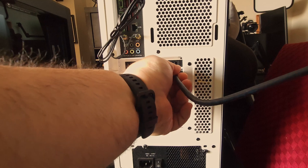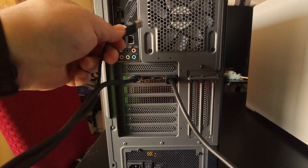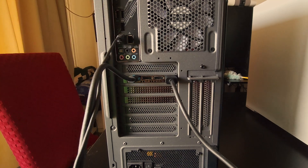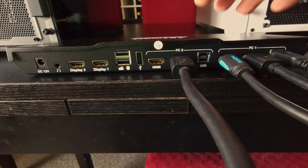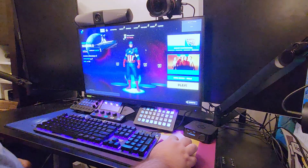All you need to do is connect the outputs of each PC to the KVM switch. You have to make sure to connect both inputs to the PC to take advantage of the dual monitor setup. You also need to plug in the USB-A to USB-B cables into the appropriate PCs to be able to control them from the plugged-in devices, meaning you can control it all from just one single keyboard and mouse.